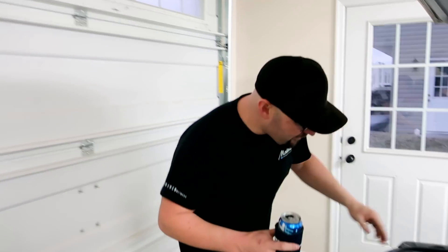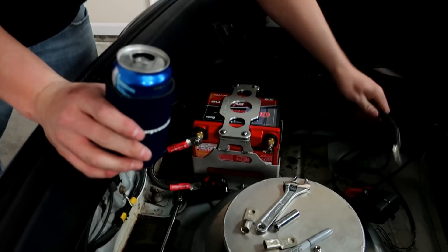God bless Keystone. Second — and this is important — remember to take your ground strap off before you put your power wire on and touch the body. That is a no-no and sparks shoot everywhere. Don't be a dumbass, aka me. Ground strap is there, we're good, putting that off to the side.